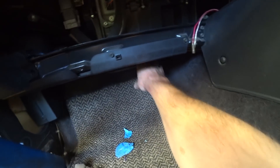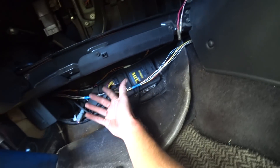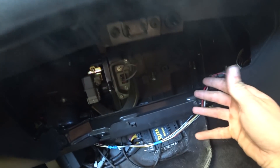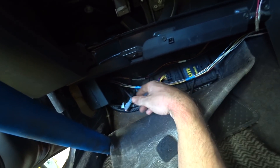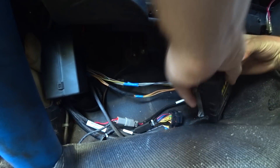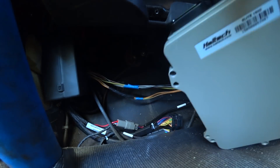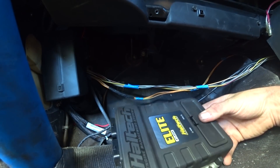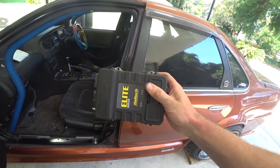I got the ECU in position — it's going to be right back here in the passenger footwell, and I'm still happy with that mounting location. If this were more of a race car without all the HVAC stuff, we could just put it on the trans tunnel, but it's pretty packed in here. Got the fuse box mounted in a nice, easy-to-access spot that's tucked out of the way. We'll need to trim the trim piece there. I want to build a plate to mount it to and then build a cover plate as a kick panel so I don't have to worry about passengers' feet kicking the ECU or the wiring.